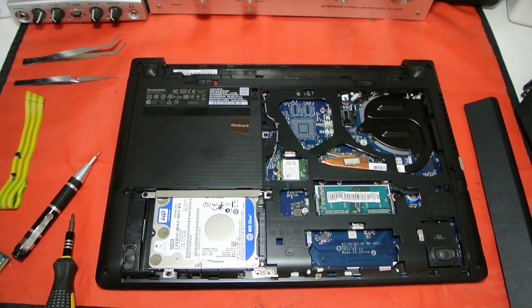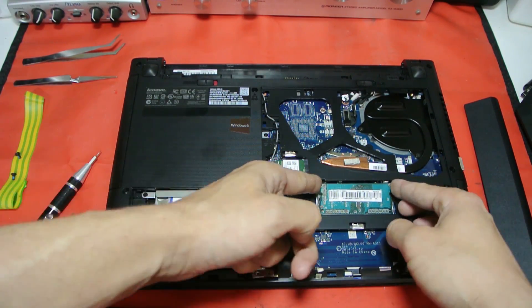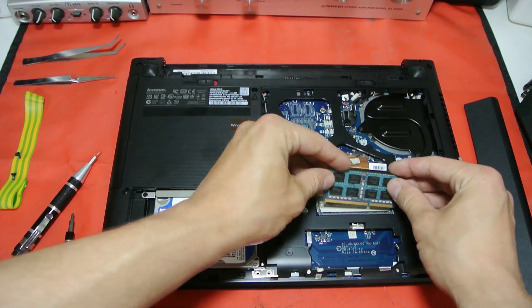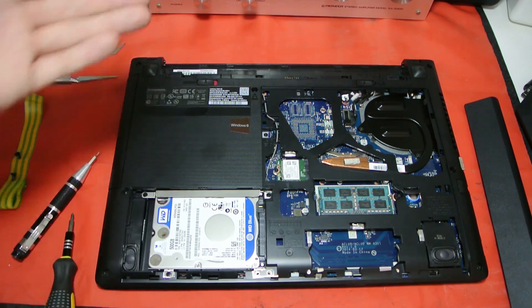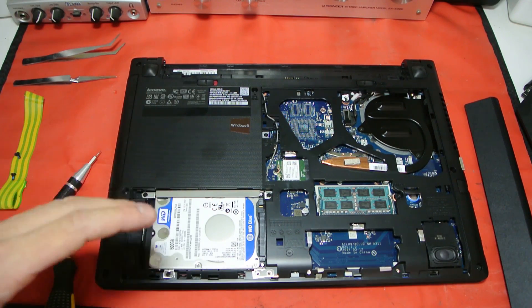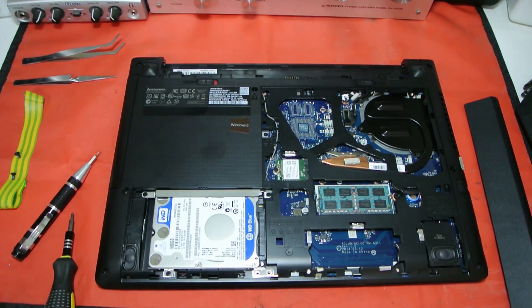Now that you're in the laptop you can swap out the RAM stick. There are two little flaps — pop it out and insert the new one. I've just got a 4GB stick at the moment, one I had sitting around. Put it all back together, put the case back on, put the battery in, and power it on. If you get a black screen, just remove the RAM again and check that it's inserted properly.